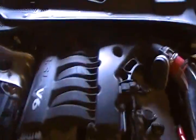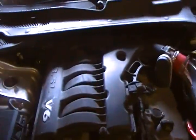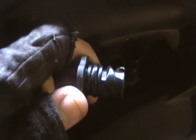Now in these cars, from I believe 2005 till now, they all have sealed transmissions, so you can't check the transmission fluid. There's actually a little reservoir here that says for dealer use only. There are aftermarket dipsticks you can buy and stick in there to check the fluid, but somewhere on here it actually says you don't need to flush the transmission fluid or anything like that because it's all synthetic. As I bend the thing, just get that back on there.